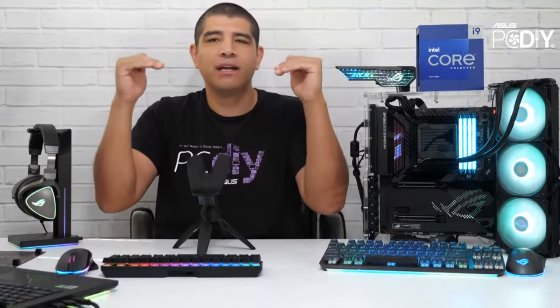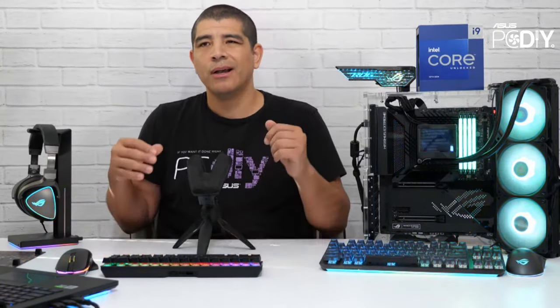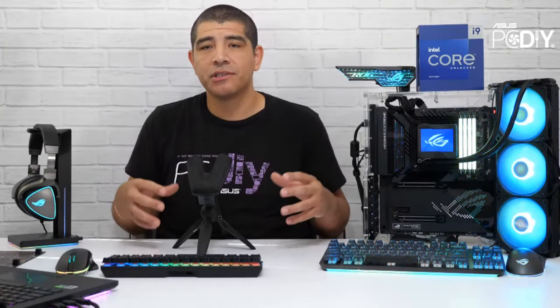But even under editing workloads, if you were to run applications like Adobe Premiere, which do use quite a number of threads, it doesn't heavily saturate the cores in the same way that a rendering application or certain types of modeling applications utilizing multi-threading would. So keep in mind that overall power and heat are directly tied to the workload experience. While you're going to see a lot of reviewers touch on the peak levels, always moderate that against what you're really doing in your system, because there could be sizable deltas.